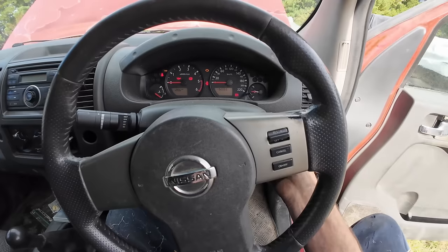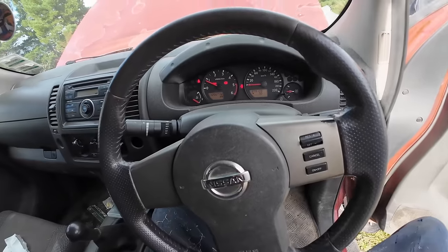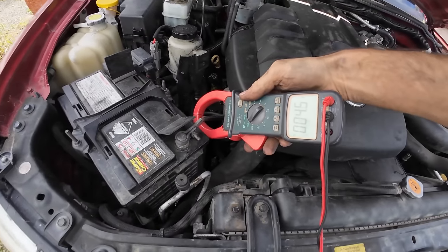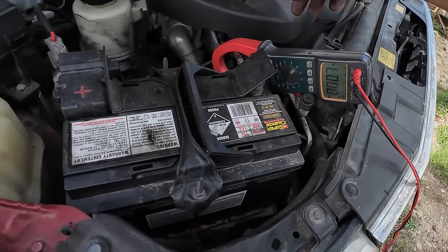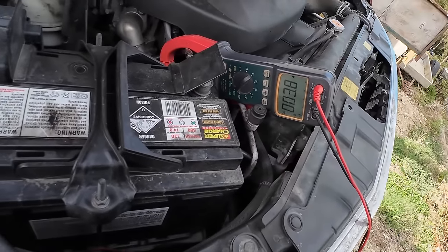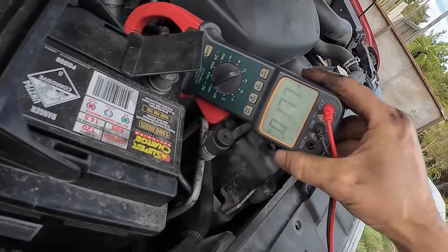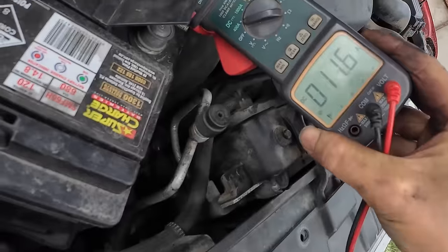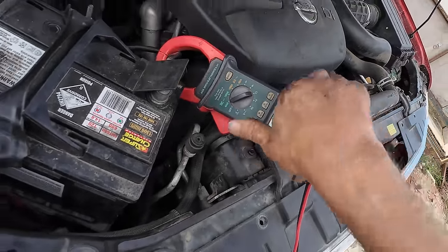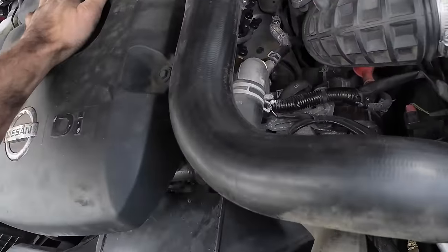All right, the moment of truth. It's sounding a lot better — no more horrible noises there. Yeah, that's charging. I'll turn it off and start it up and just see — make sure it's drawing a good load. Yep, that's looking really good. That only took a few seconds to charge the battery back up — that was at 30 amps. So that's all good. I think we've solved the problem there.